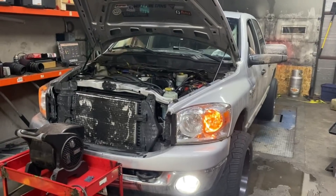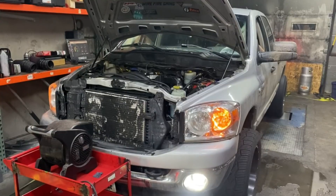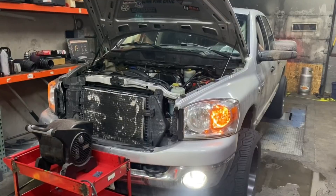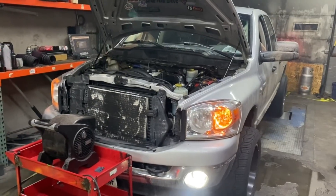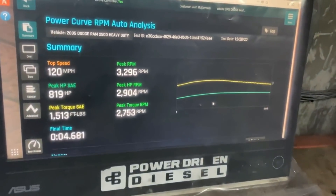We're fighting a little bit of load. What I'm going to do is have Shad raise the start point to 2,400 RPM on the run - that's when the simulated load comes in. I think we're almost kind of snuffing the turbocharger as it's coming through the test window. That last pull, the engine got to 226 degrees, which is way hotter than normal. You guys could see that window took forever to finally light up, so we're going to raise the start window.